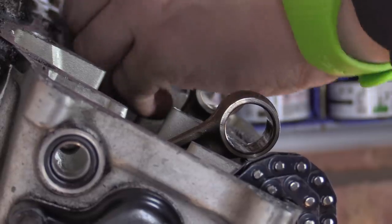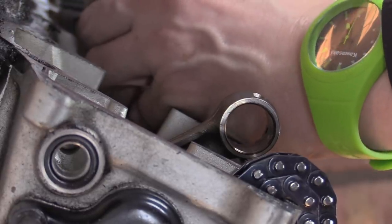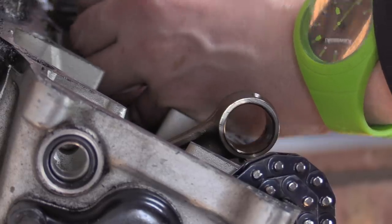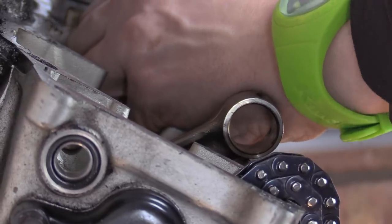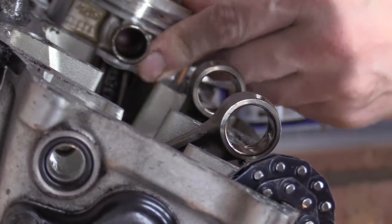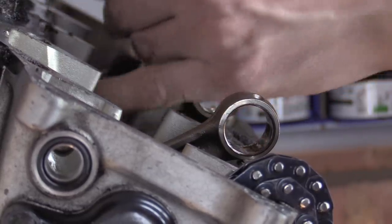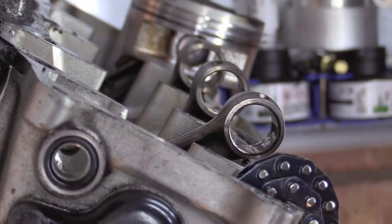You don't need to keep your ring clips — your snap rings — with each individual piston because you're going to bin them. Once they've been in an engine this long and stressed out, bin them. Stick your finger in there — she's lubed. There we go. Lightly drop that rod down, take the wrist pin out, place it in the bottom of the piston.